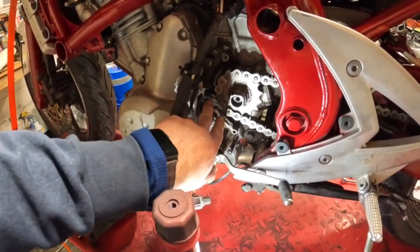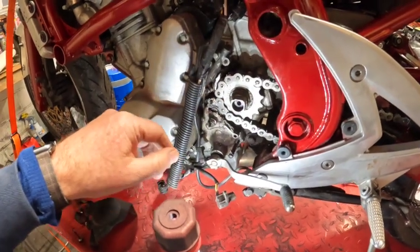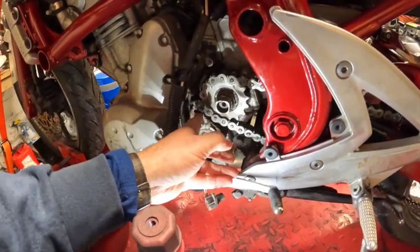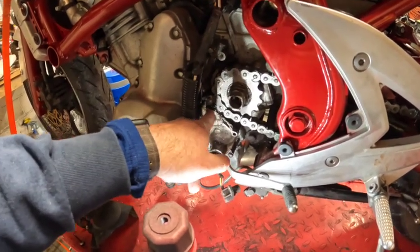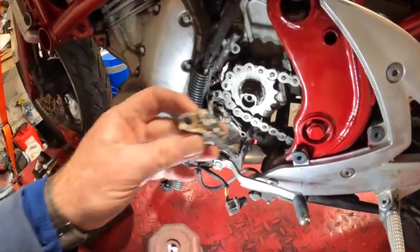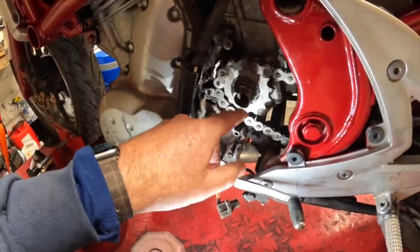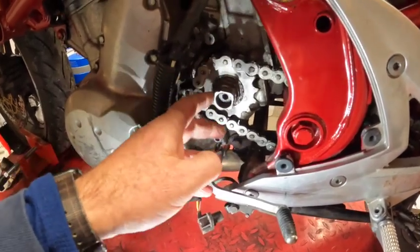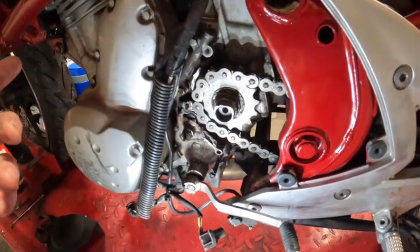It was JB welded on when I took the chain off — I noticed it. It looked like they tried to TIG weld it first and it didn't work, and what it did was build the bracket up too much. Here's part of it — it sat too far out and wouldn't let the speed sensor go around the locking nut that holds the sprocket on and register on the speedometer.